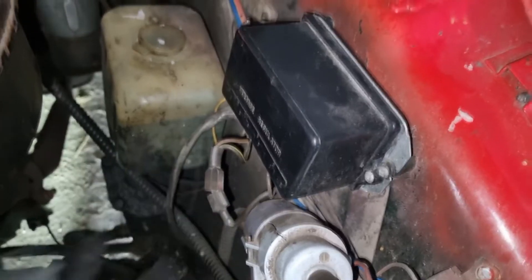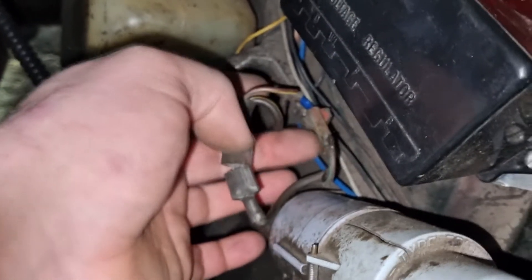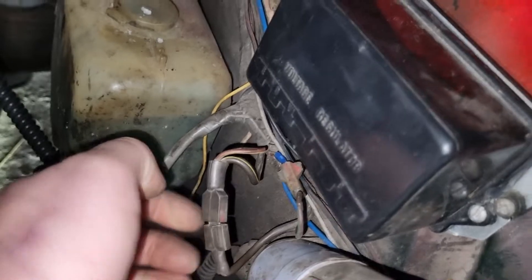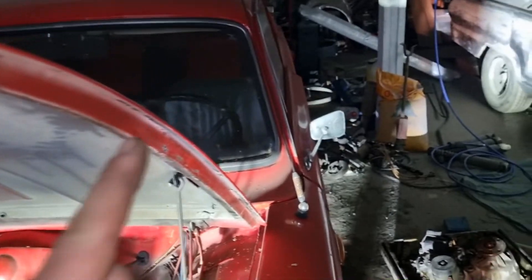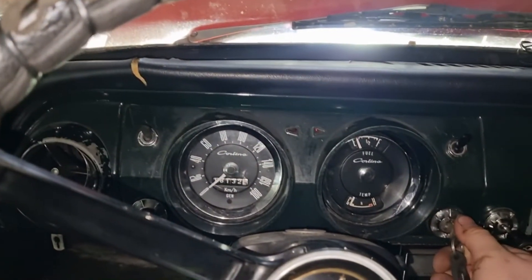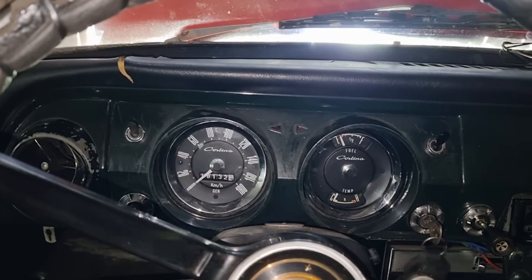Then I should have proper voltage at my battery. So let's cut this thing off, put this connector on, and see if this will work. All right, the wires are connected - this one is cut and wired into this one right here. So this is going to be the main charge wire that goes 12 volts from there to the battery. Now the charging light - if everything is all right, the charging light in the car should not be on - and it is not on. It should however light up when we turn the ignition on - and it does! That's awesome. Let's plug up the voltmeter and see what happens.